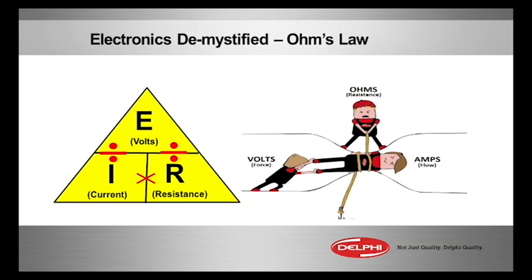If you've got some guy like at the top here — Mr. Ohms — the resistance, kind of squeezing that wire with maybe a bad connection, rust, corrosion, whatever — that's going to restrict the flow of the volume of electrons. That's measured in current. R for resistance, measured in ohms. I for intensity — they always tell you if you get electrocuted, it's that current that does it, the amperage. Electrocution's a pretty intense experience, so the I is for intensity, measured in amperes. That's the current.